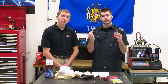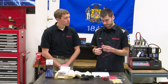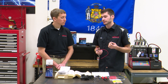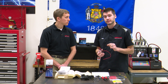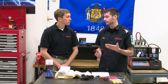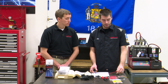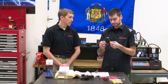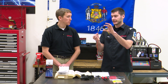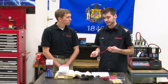From our switch, run the black ground wire back to a clean bare-metal chassis ground — something that gives you a nice steady, consistent ground connection. For power, feed back to a steady power supply. Don't jump into some other existing fuse because manufacturers use the exact gauge wire required for that circuit. Adding another load can blow your fuse or melt wiring and connectors. Run this back to the battery — that's your best bet. Don't go directly to the battery though; put protection in the circuit. Pick up a little fuse jumper wire, install one leg to the power side of the battery and the other to the power side of the switch. Put in a 10-amp fuse and your circuit is protected.